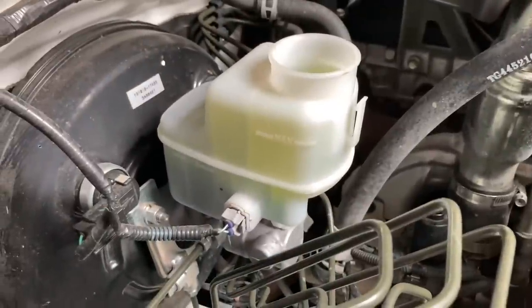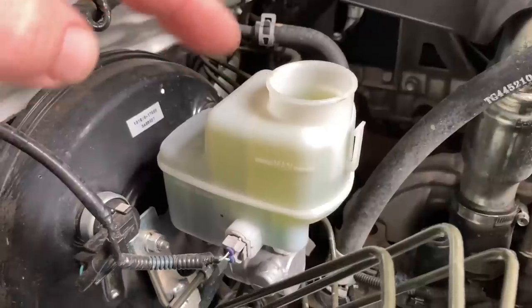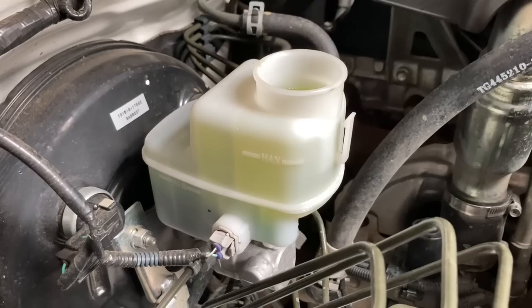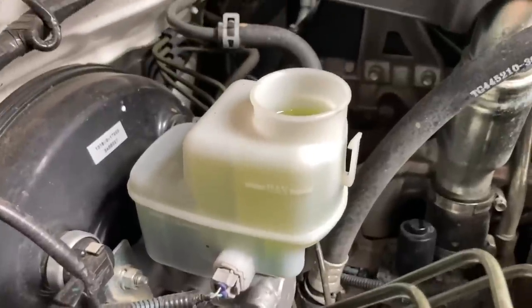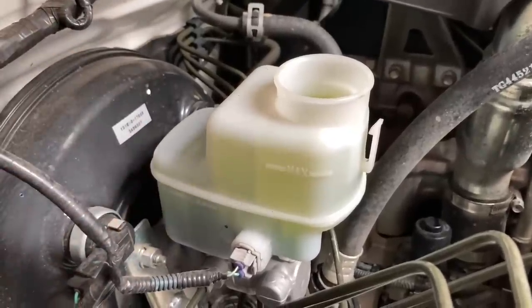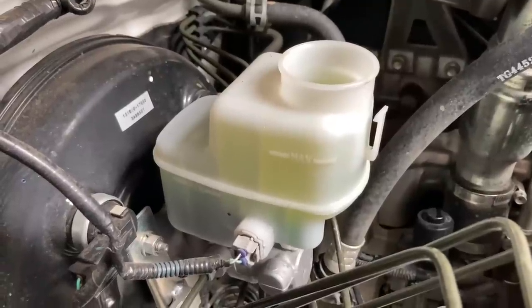So while it's dripping away, you can go and change your oil and oil filter — you can do lots of things. Just make sure you don't get dust, water, or dirt in this hole and don't forget about it, because if you let it run out you'll be starting from scratch again — which isn't the end of the world. You've just got to make sure you allow all the air to come through so it all goes through clean. There's no secret tricks when you've got the ABS unit to bleeding the brake system — it's as simple as this. If you've got the 150 Prado with the accumulator master cylinder, the only difference is you need to leave the key on. So you need to make sure you've got a good battery.